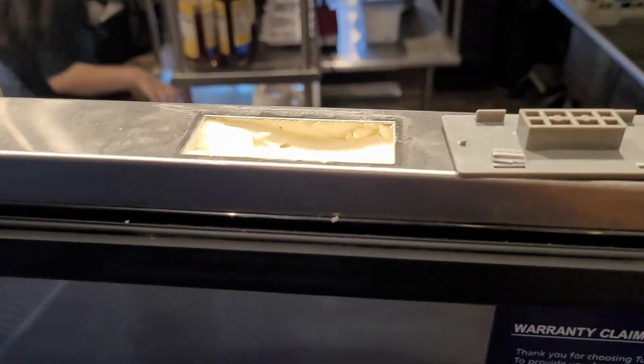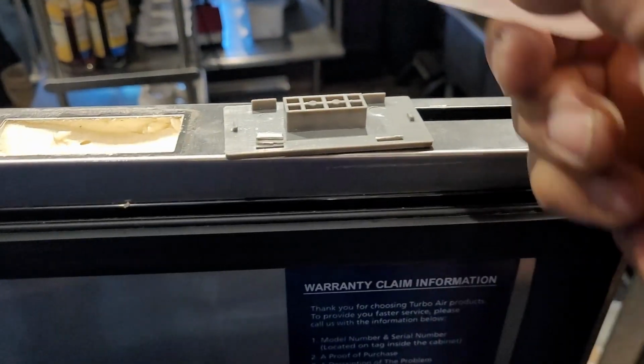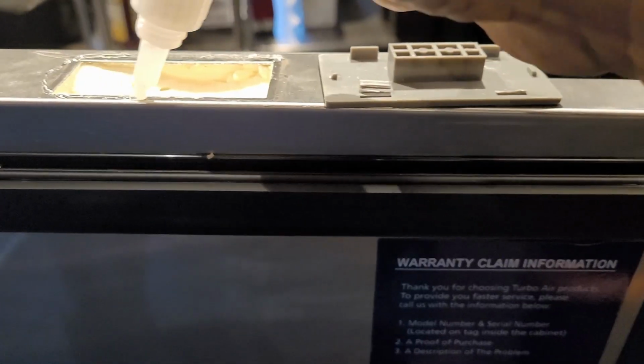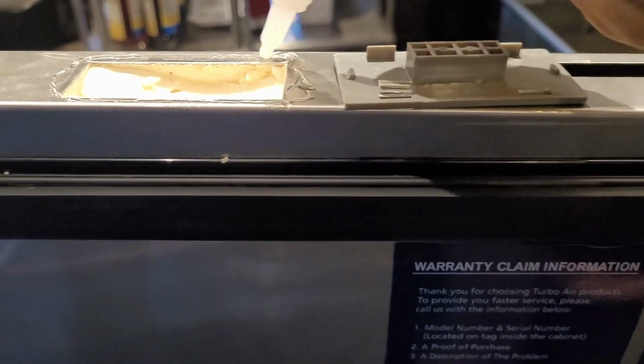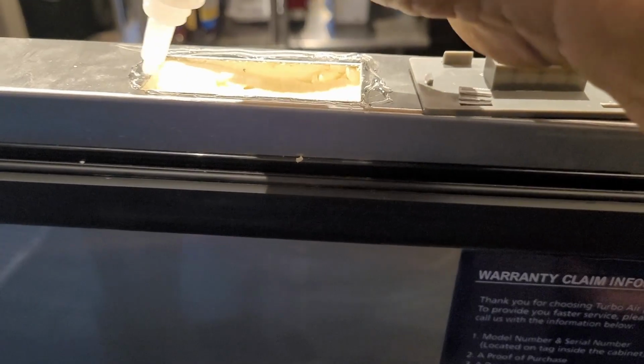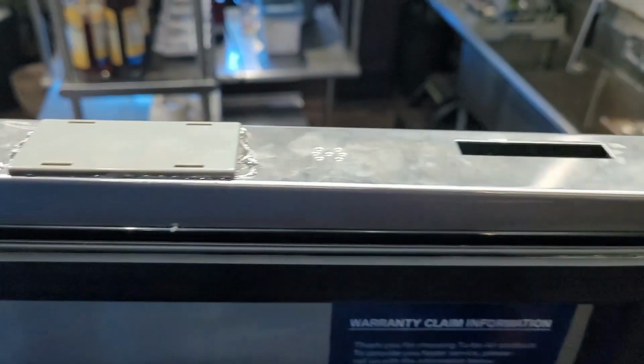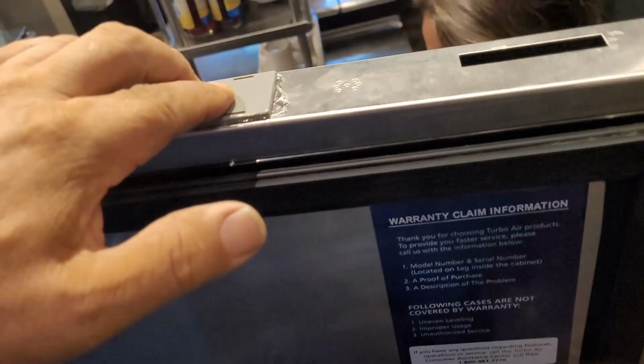Now, let's put this magnet back in the door with this hot glue. This is really simple. You put the glue around this groove evenly. I am going to put it on one more time to make sure there is no empty spot. Once you think you have applied the glue well, attach the magnet on it. Press hard and hold for a few seconds. I think Gorilla Glue is really good. Even those who use it for the first time don't have much trouble.